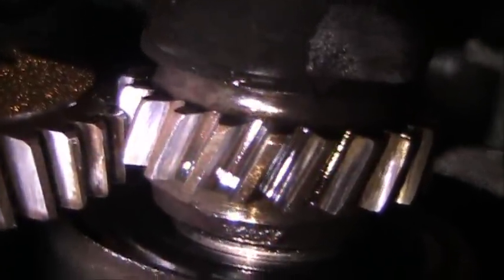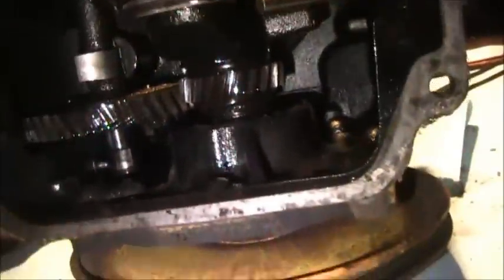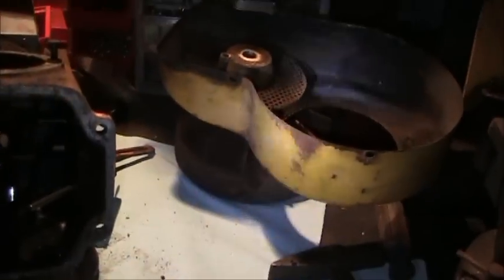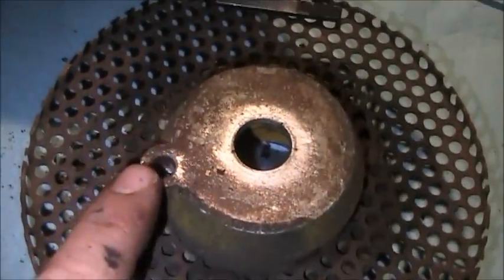The lobes look fine and I don't see any wear, and the gearing here I don't see any bad wear. So I'm fixing to take the connecting rod out — I've got to get the crank knocked out first, then pull the piston out, take the cam out, and take the block to the machine shop. Surprisingly, the flywheel came off very easy, and that was the only thing holding me up. There's a little dowel pin, as you can see right here, that this sits in — and of course it was frozen in it. So I got the back plate knocked off.